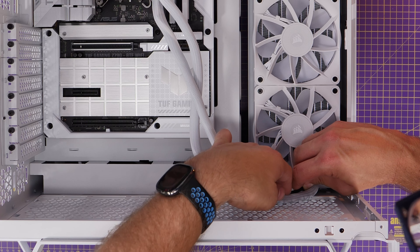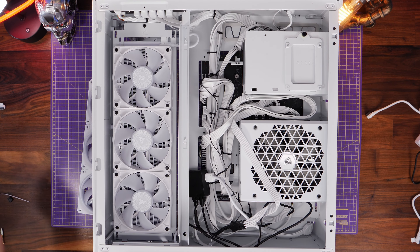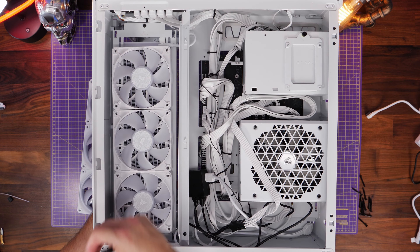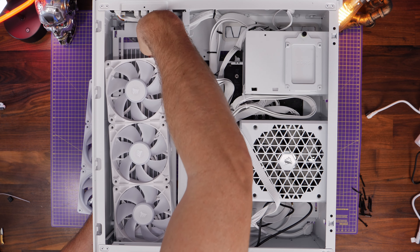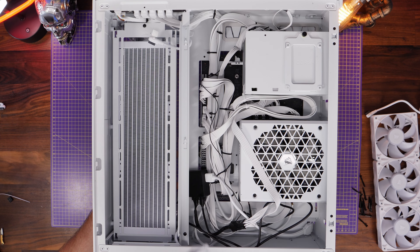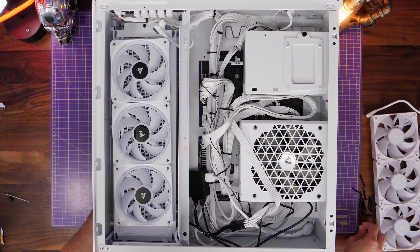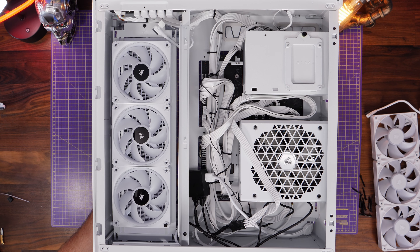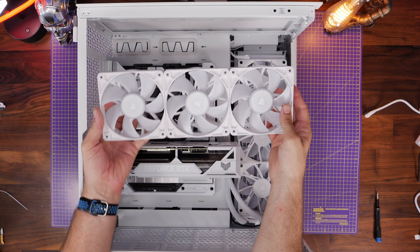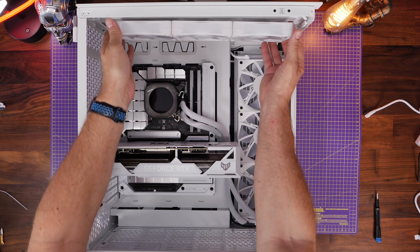Historically you could only plug seven devices per side of the controller, so it's actually been updated to 12, which is why the fans aren't lighting up until you update. You need to go into Windows to update the firmware on the controller via iCue. Also, plug the USB connection from your motherboard to the bottom of the radiator so the display will be recognized properly in iCue, allowing you to adjust it to show temperatures and other things on the pump head.